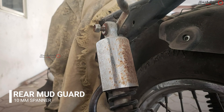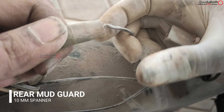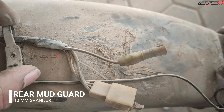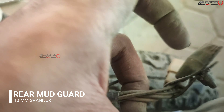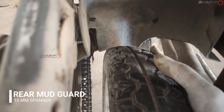After removing this we have to disconnect the brake lines — one brake line, and then there are two indicators. The brake line is a common line: one connected to the battery line and one connected to the brake switch, so when you apply the brake the light glows. All the wirings are clipped and we can easily unmount them at the bottom. After doing this the entire rear assembly is detached.